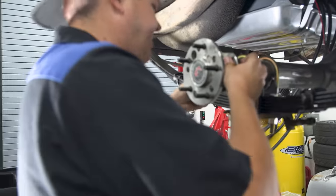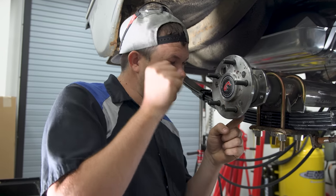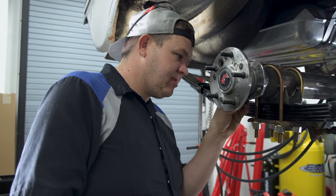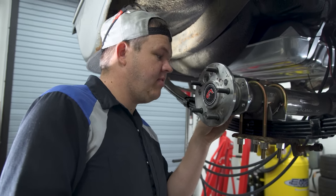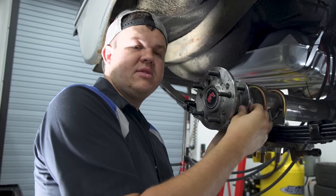This side's in. We've got to drill out the rotors just a little bit so they'll fit on these shouldered studs, so I've got to wait for a drill bit. I'm going to come to the passenger side, get this axle installed, get the brackets to the same point as the other side, and then do the discs and spacers and everything else.